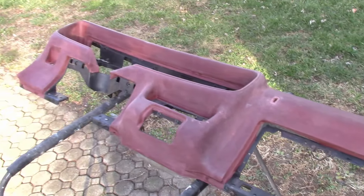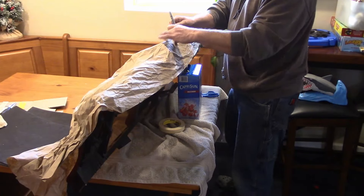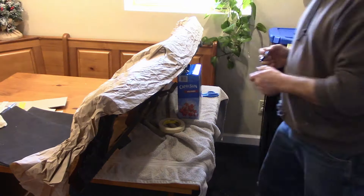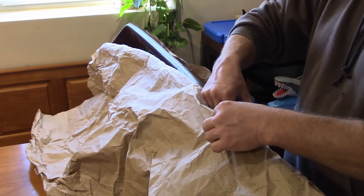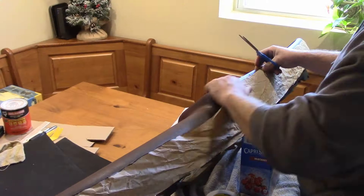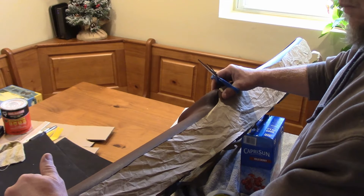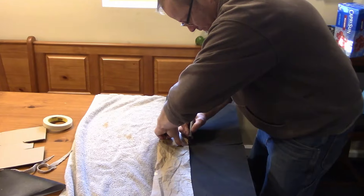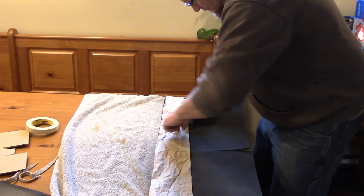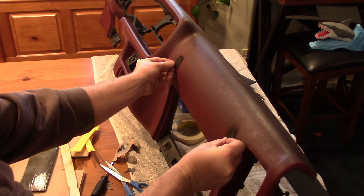Now that we've got it all cleaned, sanded, and wiped down with acetone, we brought it inside because it's a little cold out in the garage for using glue. I've got some masking paper here — I'm just going to lay it across the top and make a template. What I'm working towards is to put a piece of foam on the top of this dash to recreate the pad and cushion and cover all of those cracks and divots. We'll use this 3M closed cell foam — it's very similar to a lot of automotive thermal barrier materials. We're also making a couple cutouts to cover up the grab rail so that it does not show through the vinyl.